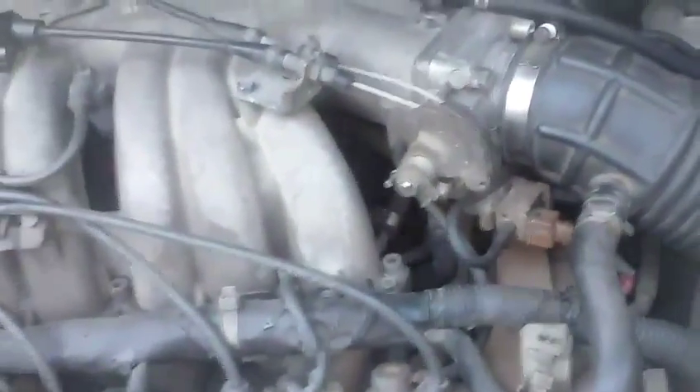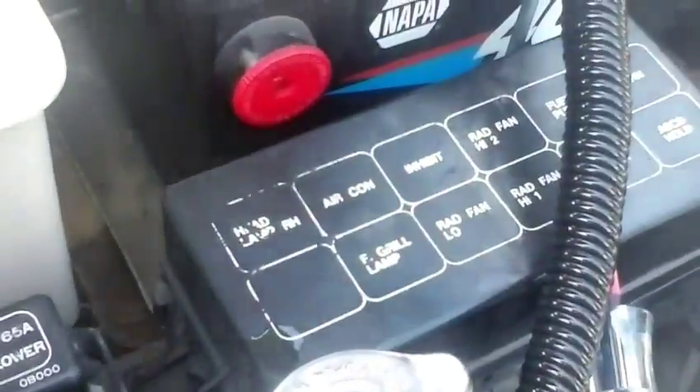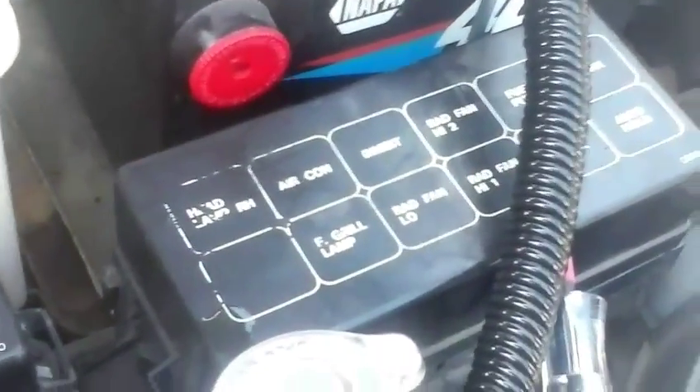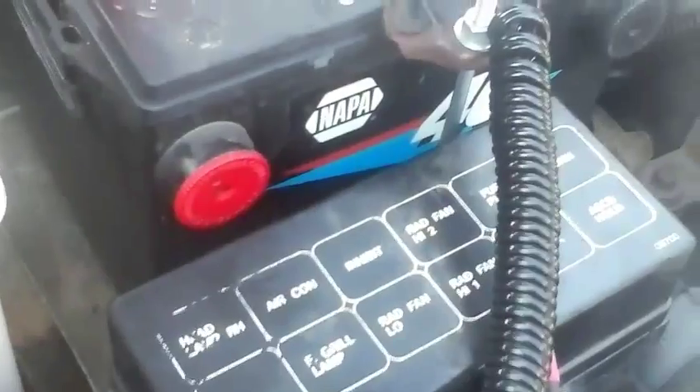The wiring appears good. The sensor appears good. The car was extensively idled at 3,000 RPM and it didn't overheat. No bubbles came up in the funnel. Why didn't the fan come on? Surely it should have been triggered. I tested the fan directly with power — it does come on if you put power right to it. I checked all three relays — they all went click and showed continuity when the coil was energized. So the coils are good, the fan's getting power, the wiring checks out, so does the sensor. Why no fan? It's a mystery.